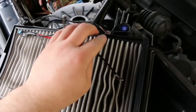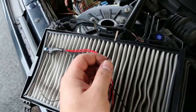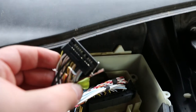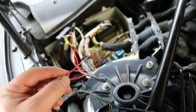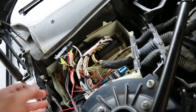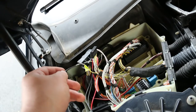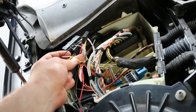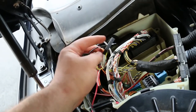Now grab the DP fix. Take the two black female wires and insert them into positions 19 and 20 — they're interchangeable, so it doesn't matter which one goes where. You should hear an audible click once those wires go in. Make sure they go in the same way the other ones came out. Next, take the red female wire and plug it into position 23. Then take the red male wire and plug it into the black and red striped wire you took out of position 23. After that, take the male black wire and plug it into either position 19 or 20's wire that you took out — not into the connector position itself, but onto either of those wires. Make a note of which wire is which.